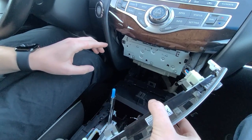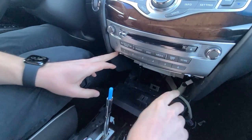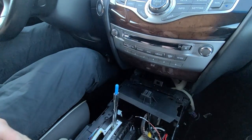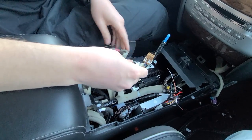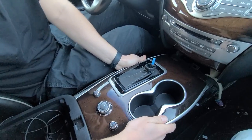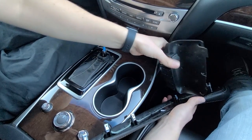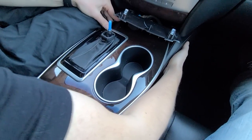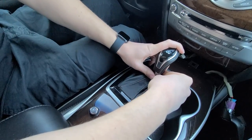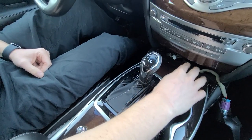Once we've tested everything, we can continue with the assembly. Put the two Phillips here and clip it in place, then put the two Phillips down here. Now take this panel and clip it back in place. At this point, put the center console back — take it and connect all the connections. Then put four Phillips on each side of this panel. Take the side panels, clip them in place, and tighten those Phillips. Take the shift knob, lower it all the way down, put the clip back, and put the leather boot and clip it in place.